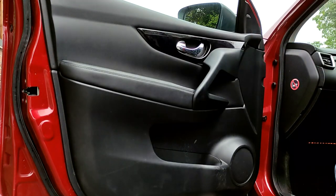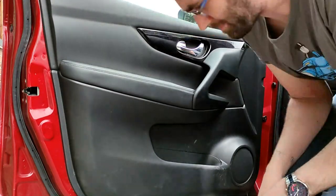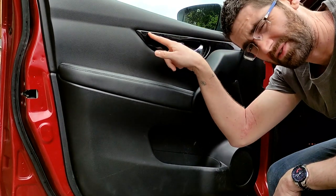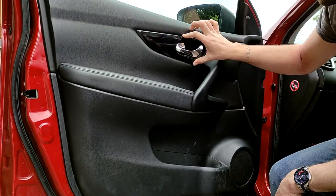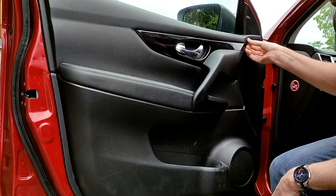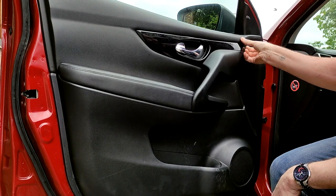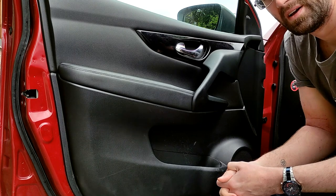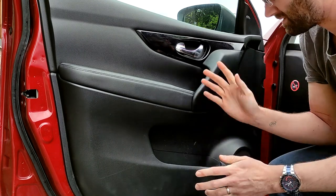So to remove the door card, we're going to need to remove the parts of the door first. So we need to remove this trim here. I don't know if you can see me or not on the screen at the moment. It's ideal to use a plastic pry tool or something. Unfortunately, I haven't got any, so I'm going to use a flathead screwdriver. But if you want to get a pry tool set, I'll put a link below to Amazon for you to get one. So let's get this off.